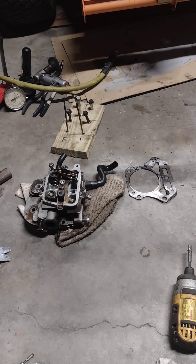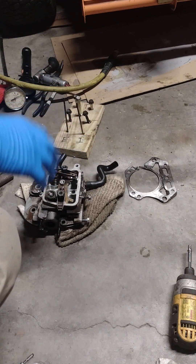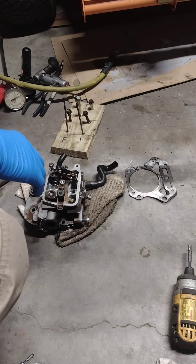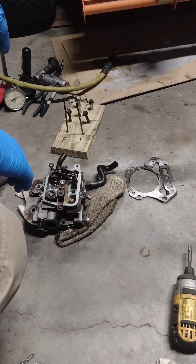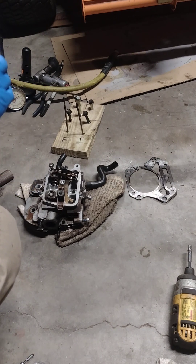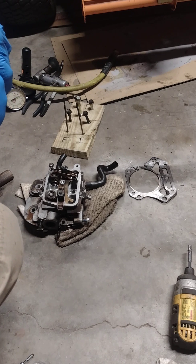So we've got to replace that head gasket. I checked the head and it's true — it's not warped. What led to this was an oil leak on the crankshaft and flywheel seal, and also the breather — all the bolts on the breather plate were loose. So oil congealed, all the grass debris got in there and overheated this engine.